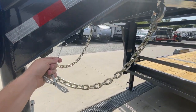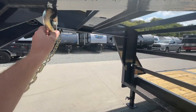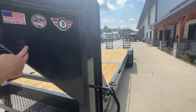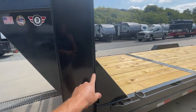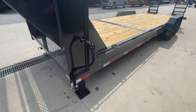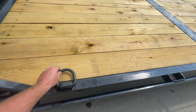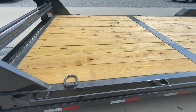The trailer has your required breakaway cable for safety, safety chains with an integrated holder, and a spare tire mount in the neck, which is nice. You've got neck gussets or doublers going from the vertical to horizontal and from the vertical to the frame. It's also got dual 12,000 pound jacks with the spring foot, stake pockets, rub rail, and four-inch D rings.